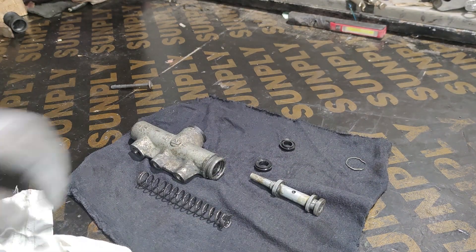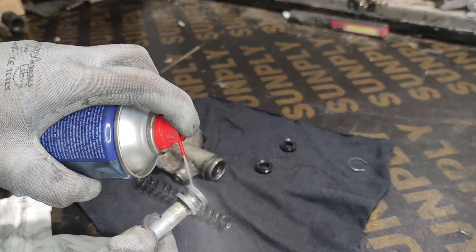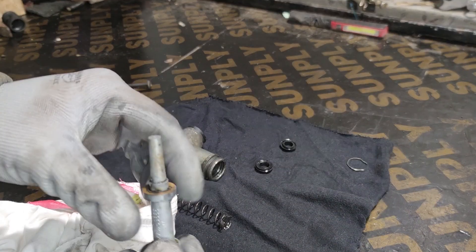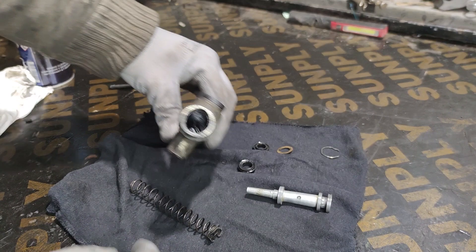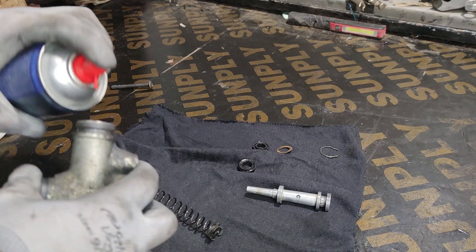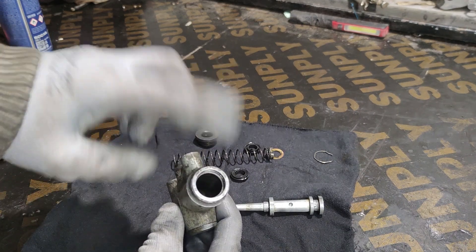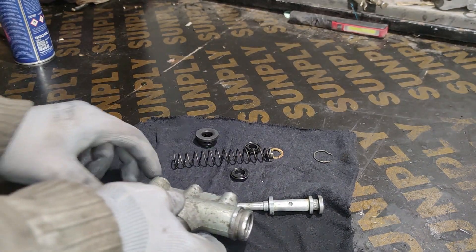With the rubbers out, fresh rag, and clean it with some brake cleaner. Now I'm going to clean the cylinder as well because it's pretty nasty on the inside. I cleaned the filler place, the banjo bolt seat, and of course the inside. I paid some special attention to the retention ring seat so it can sit back in properly.